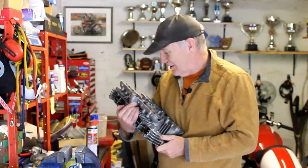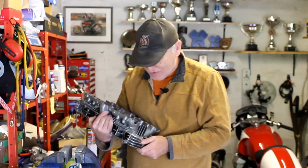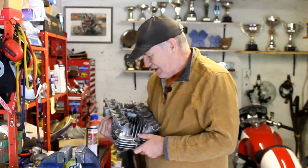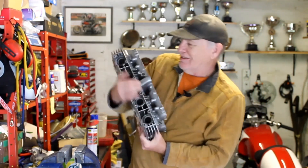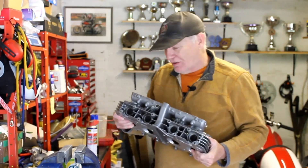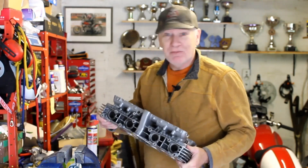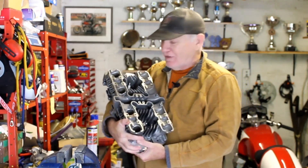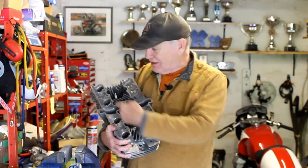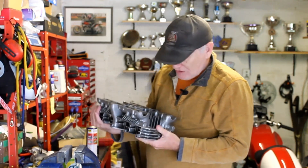So I've got to remove all the grit and fine sand from all these galleries and oil ways, and that's not going to be easy. I originally thought I'd just get a high-pressure hose, go to my mate who's got a big compressor, and blow it all out — but apparently not, it's not so simple. I thought maybe my ultrasonic cleaner might work, but this is far too big. Even taking it somewhere with a bigger tank, I don't think will work. But there is thankfully a solution that other people have found: when Kawasaki made this cylinder head, they had to line-drill the galleries from one side all the way through to the other — you couldn't cast those galleries in.